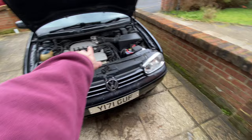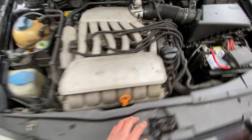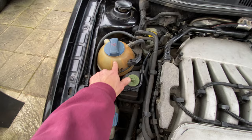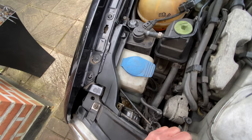Because it's coming up that high, I think I'm going to take the top of the airbox off completely and remove it so that none of that bends or breaks. I've had a look around and it should be okay to do it this way by raising the engine. I need to remove the power steering reservoir — well, just loosen it and move it out the way. The coolant obviously has to be drained, and apparently I need to take out the washer bottle as well — that should give us enough room to get in there.